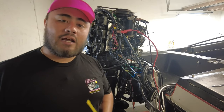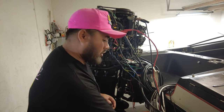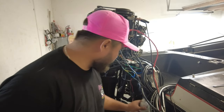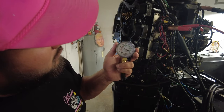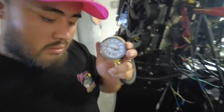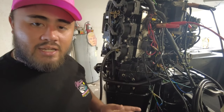So it's been about five hours and I'm going to do a compression check for the last time. We're going to see if the Power Tune from Mercury did any good and we're going to be ending the science experiment so far. Deep Creep brought the compression up to 105, so let's see how it is right now. We're at 100 PSI. I guess you can say this science experiment was pretty good — we started off at 88 PSI and we're ending up at 100.